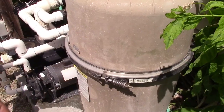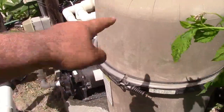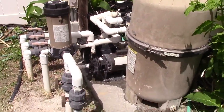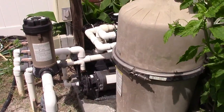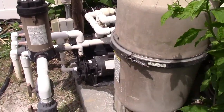And this time I pulled the gasket off of there and cleaned that off with a rag real good. Cleaned the mating surface at the bottom and the mating surface at the top, put her back together, not a single drip. Now it's perfect. A lot of times the leaks will just sort of seal themselves somehow, but that was not in the cards this time for whatever reason.